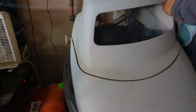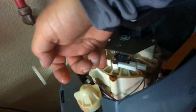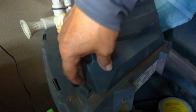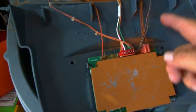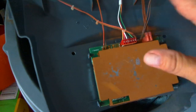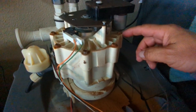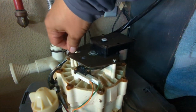It's really easy to remove the cover, disconnect, and push in the bypass. You can see there's water — it was leaking very, very slowly, just a little bit of water coming down. To remove the face plate, all you gotta do is push here this way. There are all the electronics and a lot of cables — don't mess with those. This is the eight-bolt model, not the five-bolt, so be aware of that.